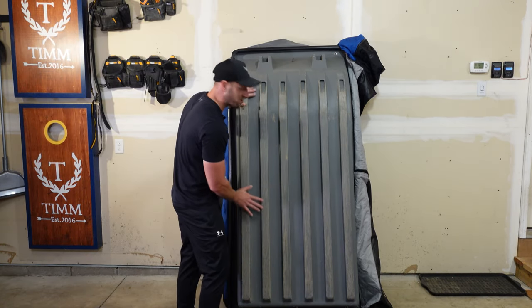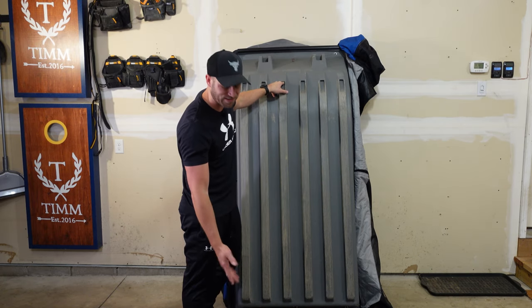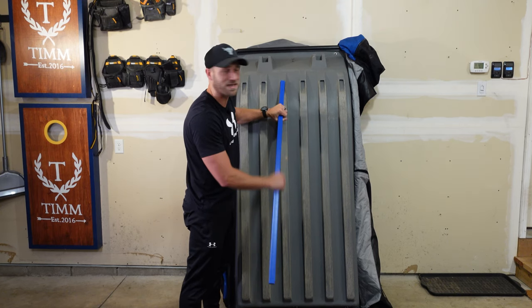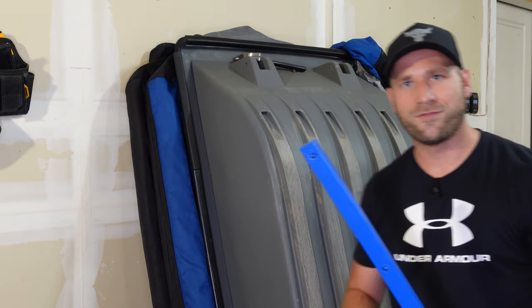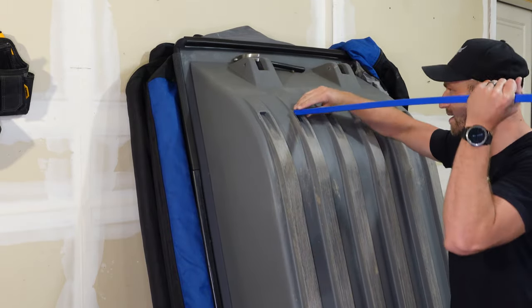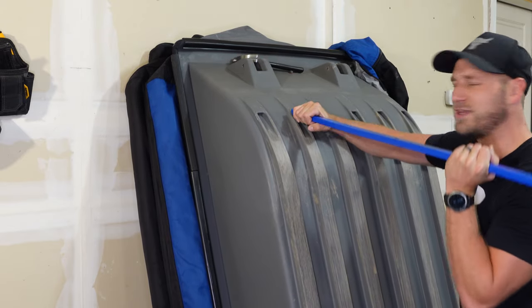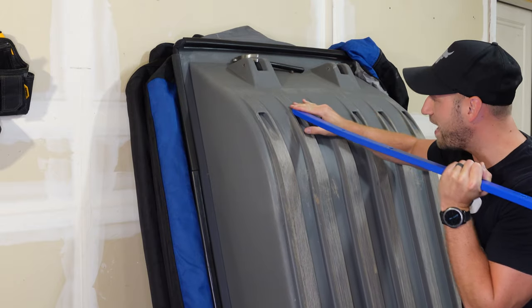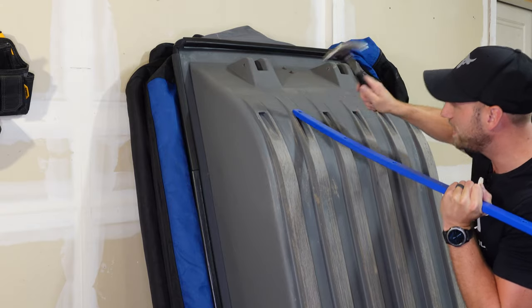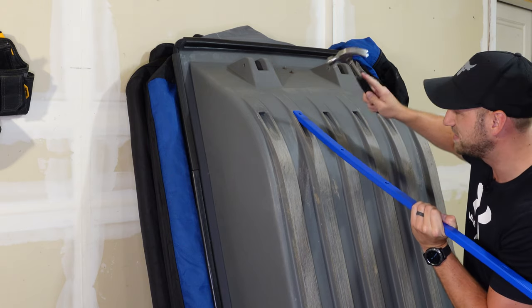Next, what you want to do is tilt your sled up against a wall so that way the grooves — where you can put the HiFax pieces directly into, if your sled has them — are at the top. It's going to be easiest if you can jam it in there. So once you have your first HiFax piece, it doesn't matter where you start. You're going to want to jam it into the groove at the very top, so make sure it's as far up as you can get it into that groove. Put the top corner angle of the HiFax in to get it in there a little bit, and then use a hammer and pound it in while applying upward pressure to make sure that it's seated towards the top.